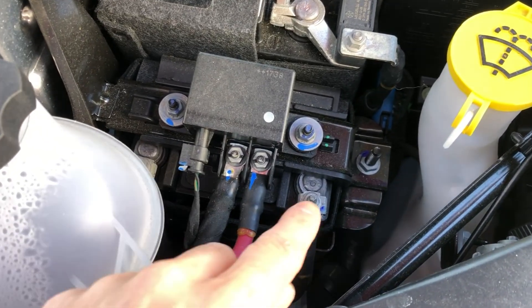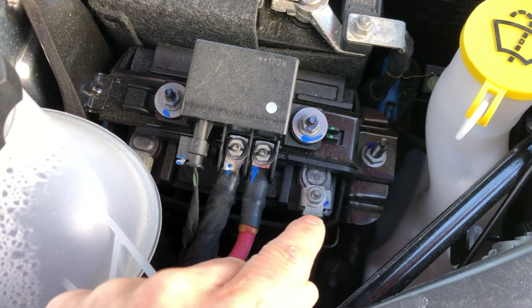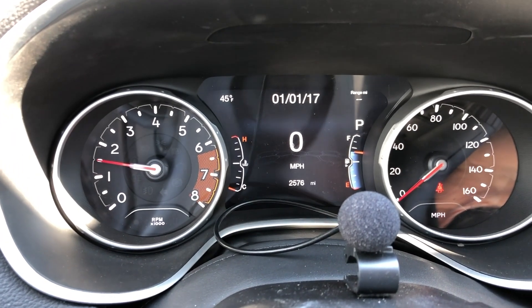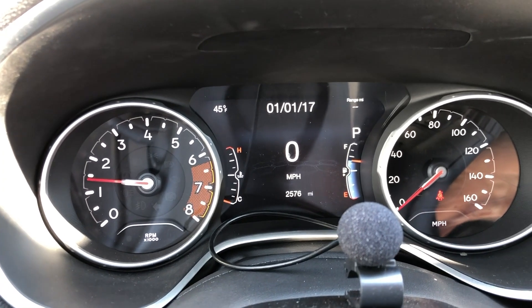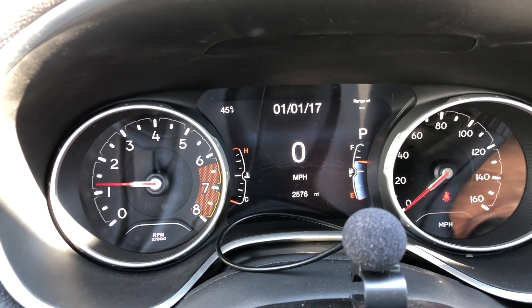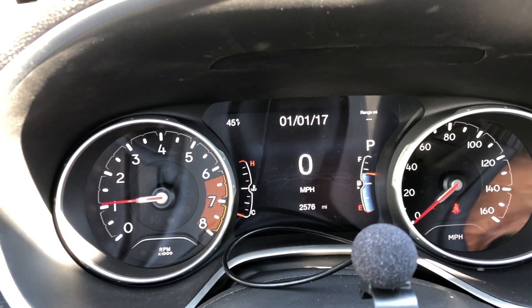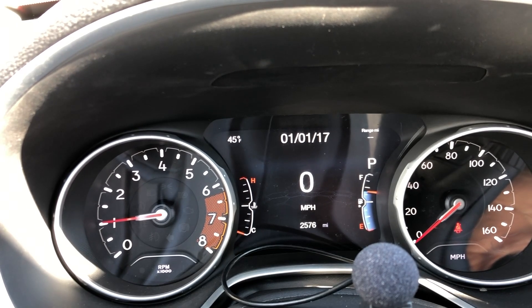That other connector for the secondary battery that I disconnected was this one over here to completely cut the power to the vehicle — it was this nut, and obviously the primary battery right over there. And there you have it. You can successfully swap out the 3.7-inch for the 7-inch LCD screen. I will have to go to my local Jeep dealership and get the cluster's mileage fixed — that was to be kind of expected. I also need to get that date fixed on the top there. As always, if you like what you see, like the video, leave a comment below, subscribe to the channel, join our forum. This is Dan from South Hawk Computing — until the next time.